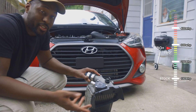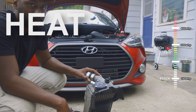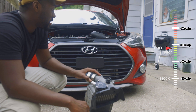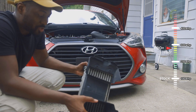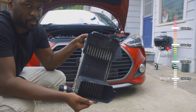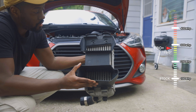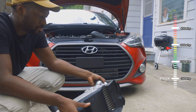So we're chasing somewhere between 200 and 300 wheel horsepower, and we need to address heat concerns. The first question is: do you use an intercooler or water-methanol injection? I would say with water-meth injection, your stock intercooler can get you to 300 wheel horsepower. It's a flow restriction, but not that big of one, and honestly you're going to see better results on the heat side as long as you have meth in the tank.